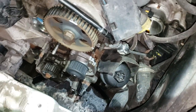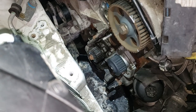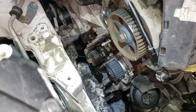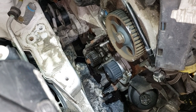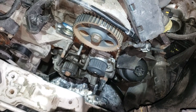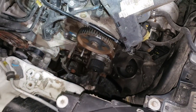Okay, it's all torqued in there now. All we have to do is let it dry. In the meanwhile, we're going to brake clean the area where the residue from the coolant is on the oil pump. You don't want to soak it in brake clean — first remove as much crap and dirt by hand, then use a rag with some brake clean and a blower to dry up whatever crap is there. After you spend a good amount of time cleaning this section and getting as much debris off the oil pump as you can, you are now ready to set your belt up for success.